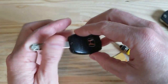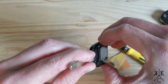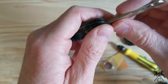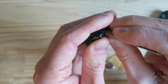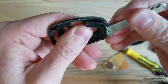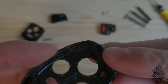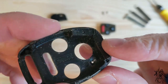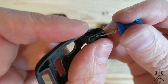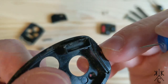Then I bent the metal key. As a disclaimer, you have to be willing to pretty much use this key, and hopefully this is a backup key or something. I do not recommend doing this with only one key. You need to take the key out of that little area, break it out of the plastic, take the metal key portion, and get this little magnetic strip out of its compartment — you can take it out with a little pin or bulletin board pin. Be careful with this: if you break this, your key will not work.